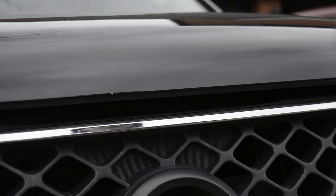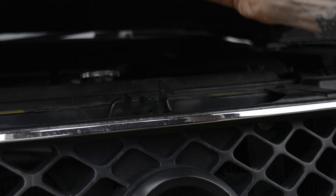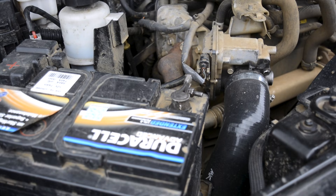It's a little difficult to get the camera to show exactly where it is, but it's just above the fuel pump on the left-hand side if you're in Europe. Get yourself a Denso suction control valve — there are a few retailers who sell them, they're the original part Nissan used. You'll also want a small ratchet wrench and some Allen key bits; I think it's a 10mm but you should see that in the video.